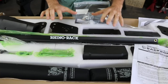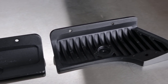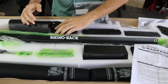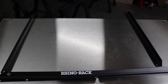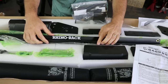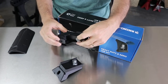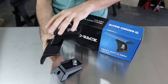In this box is the heart of the Rhino Rack Backbone System. It comes with these cast plates that get mounted on the outside of the hardtop — three on each side, really sturdy and strong. There are internal plates that get mounted just over the front seats, and then the core of the system is this internal skeleton that goes around the rear window to add a lot of extra support. This is what really gives it its sturdiness internally. There's a bunch of hardware, some excellent directions, and a little bit of padding as well.